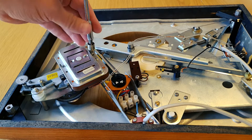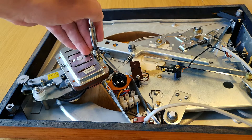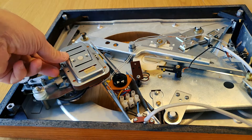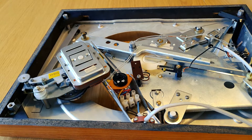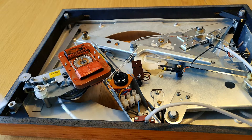The correct way to lube these machines is to use something called white lithium lubrication — it's like a spray. You spray it, and when it comes in contact with another material it becomes this very lubey lube. We need to remove all the dust in here, and the old lube is probably like glue right now, so we have to remove every trace of that, be very very careful.